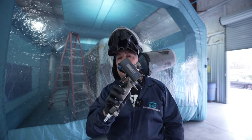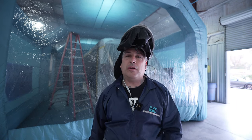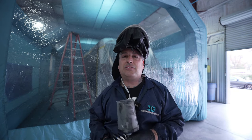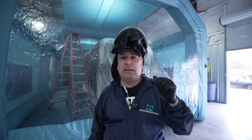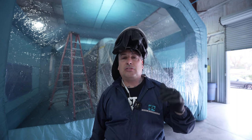So far, so good — it laid out nice. I could see what I was doing, but now is the best time for the old Luma light. We're going to be using the Exodus on this one. I can feel what I'm doing with the sealer since I'm just getting coverage over that area for adhesion, but with the base coat I want to make sure I can see what I'm doing. We're moving into the Exodus with the sunlight setting, and I think it's going to come out beautiful. I can't believe it's actually not working bad at all in there. I'm going to let that flash off and then we're moving right into the base coat.